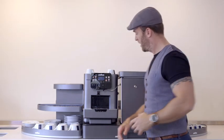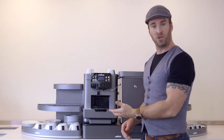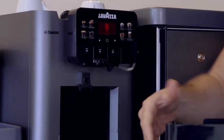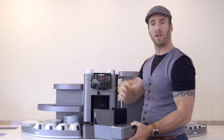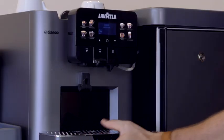In this final section we're going to show you how to clean and maintain your machine on a regular basis. The first thing we need to do is empty the capsules and rinse the drip tray. This simply slides out, the capsule section comes out and can be emptied, the drip tray emptied, cleaned, rinsed, and then reassembled and slid back into place — nice and straightforward.